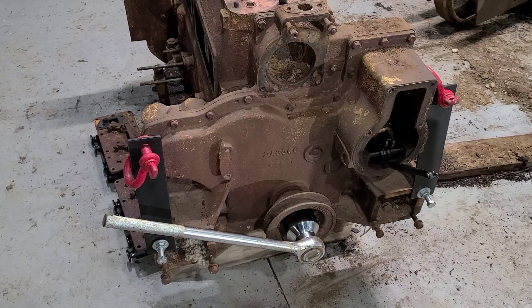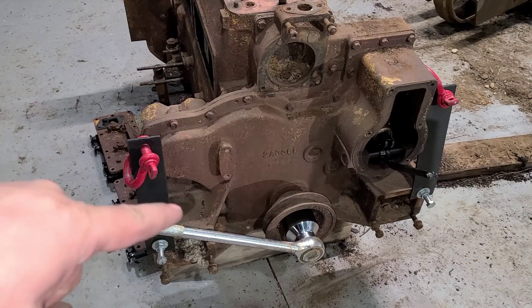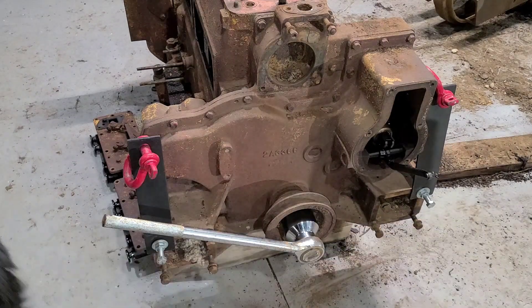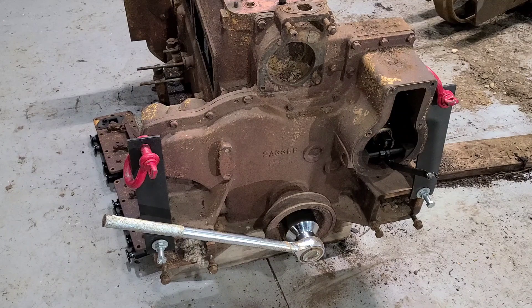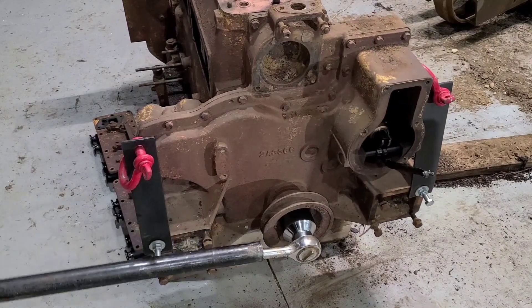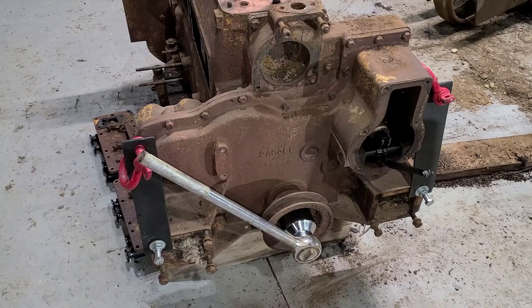Welcome back everybody. We're back at the front of the engine. I have the big sockets out along with a three-quarter inch ratchet. We're going to try and get this front nut off from the crankshaft so we can get that pulley pulled, get the front cover off, and start pulling gears and accessories out. With the six-foot cheater bar we were able to get that broke loose. I'm going to have to get a stand built before we start reassembling — the motor was rocking back and forth. We'll continue tearing it apart for now, but definitely during reassembly we're going to have stands built for multiple things.